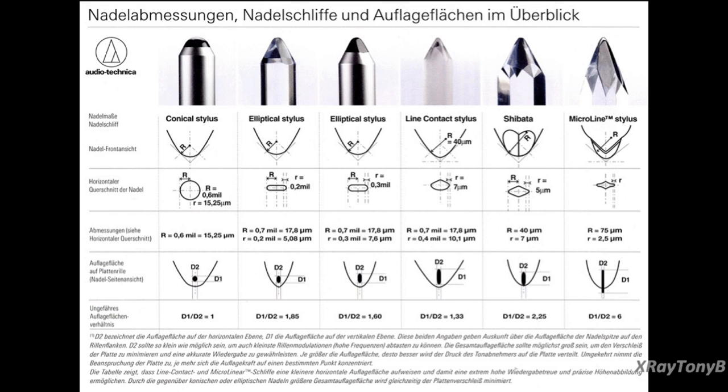Now there are different types of stylus tips. You can see from this chart, thanks to Audio Technica, some of the more common ones that are out there. Each one going from left to right gets a little more detailed in its design, and you can see the profile of how they will actually track in that record groove. As you get more complex in the cut of the diamond stylus tip, the cost goes up substantially — some styluses can be very expensive, in the many hundreds of dollars or even more. The whole purpose of each is to follow all of those tiny movements of the groove to reproduce the sound.